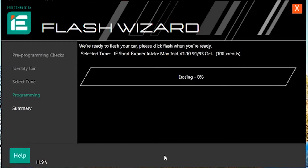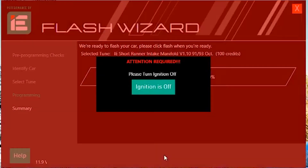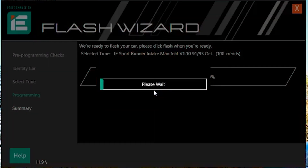The first thing it's going to do when it starts the process is begin erasing the old files. Don't be alarmed — it's got to erase the old files to write the new files, so it's just going to take you through its whole process. You will get to a couple of points during this process where you have to turn the ignition off and on again. The screen will flash red and it'll come up with a prompt that you have to turn the ignition off and click OK, then turn it back on again and click OK. You have to do that a couple of points throughout the tune. I am playing this back in real time so you guys get a feel for how long this is actually going to take — this hasn't been sped up or slowed down at all. But other than that, it's pretty straightforward — just hang out and wait for the screen to start flashing at you. Go ahead and turn the ignition off, click that ignition is off, it'll do its little process, and then it'll tell you again to turn it back on. Turn it on and click ignition is on again, and then continue.